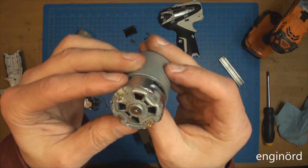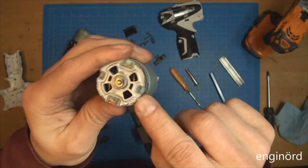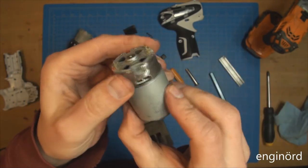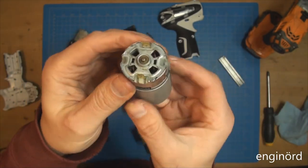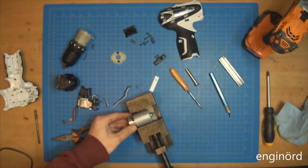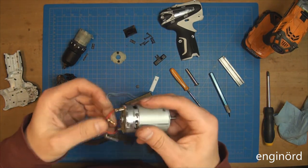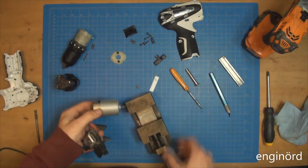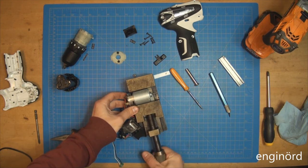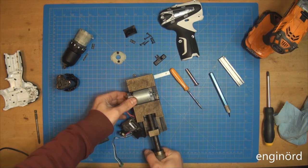Here's the crimping. So what I did, I just clamped it in a vise slightly, and then I used a punch, just added punch marks here, and then bent back these tabs, and then I sanded it a little bit because it's a little rough at the edges. Goes in a vise. So let's hook this up again. Red is to the red, black is to the black. I was going to slightly clamp it, so I don't want to compress it. There you go.